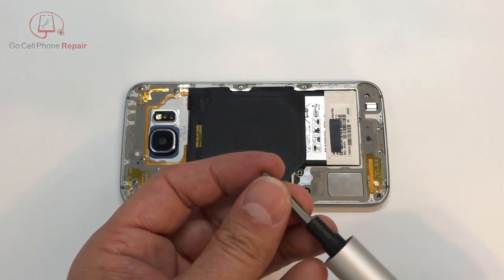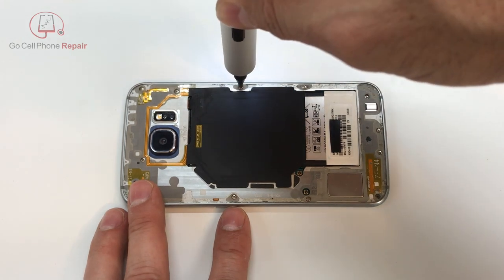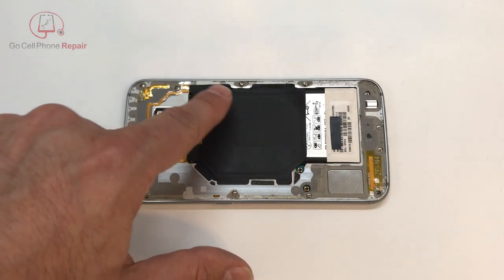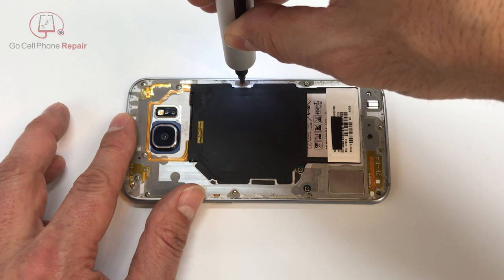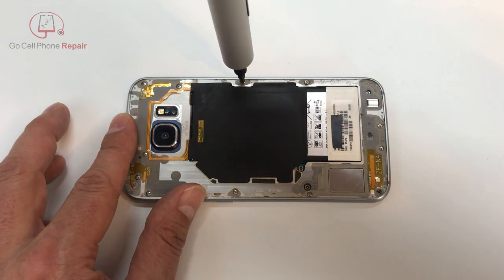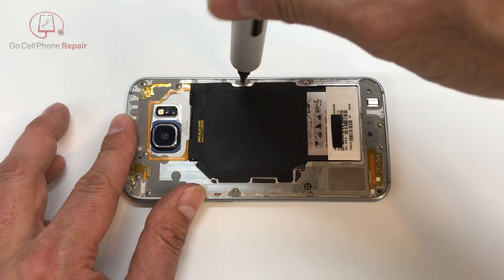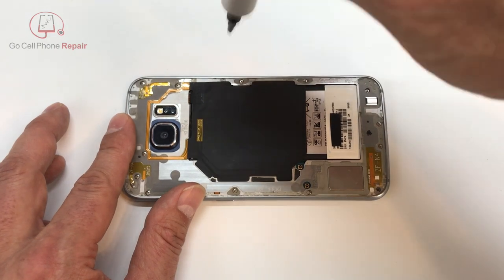Our goal is to make the process much faster. So instead of hand tightening or loosening any of these screws, you just hit the button and back it all the way out. If you've ever worked on a Samsung before, you know the second most annoying thing is that these screws don't unwind all the way out of the frame — you'll probably have to take a pair of tweezers and remove them the rest of the way. As far as installing and removing screws, it is as easy as the push of a button. If you want to torque them down a bit, you can release the driver and hand twist to tighten or loosen. There is not actually any sort of torque mechanism built in, so you have to just tighten it until it stops. As you hit the bottom of the screw thread, you'll feel a bit of a jerk, and then you know it's tightened all the way into the frame.